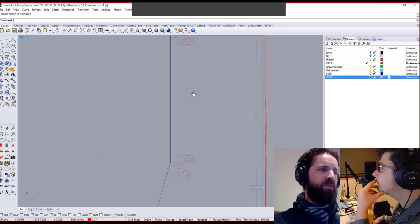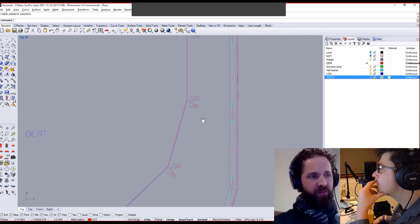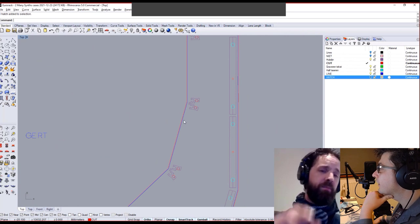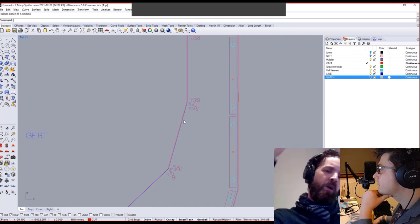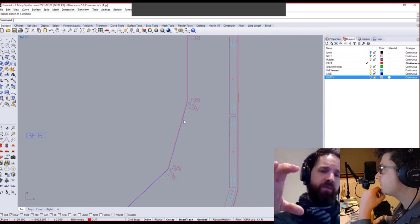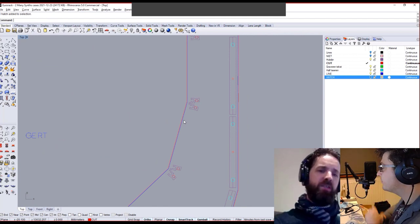Some margin everywhere to make sure that you can rotate, because that's one of the benefits of fixing the rails to the case: with an Allen key, you can loosen them a little and rotate them. So I always advise to loosen all the bolts on the side, put in your modules, rotate the rails until it's super flush, fix your modules, and when you're happy, fix it on the side.